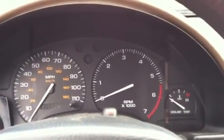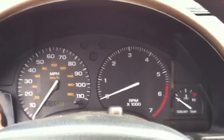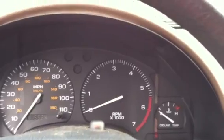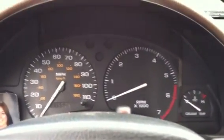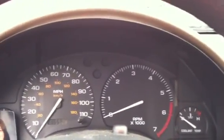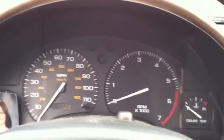So I definitely recommend that first and foremost, the first thing you do is upgrade your battery. A capacitor is a last resort. After you've upgraded your battery, and alternator if necessary, then you get a capacitor. Looking at my system, I think my next thing is going to be getting a small capacitor, just for that extra little burst of energy, so I can cut down my dimming even more. But yeah, that's my thing with capacitors. People just use them in the wrong way, don't upgrade their battery, and think a capacitor is just going to do it. So there it is, Kinetik HC1400.